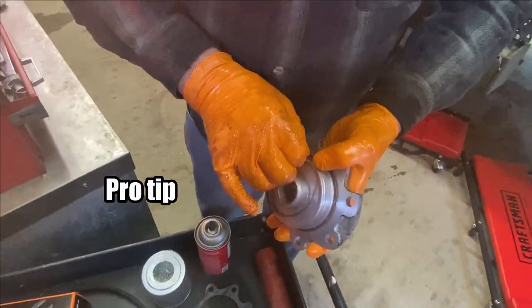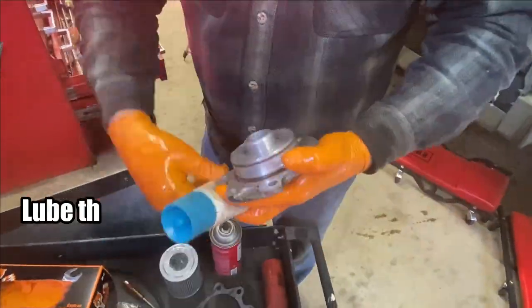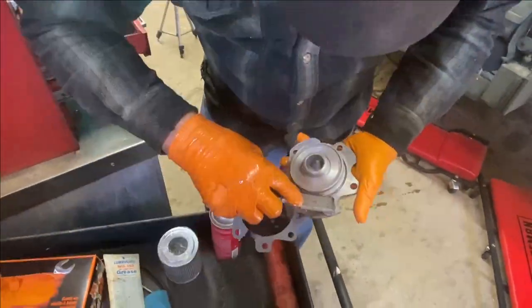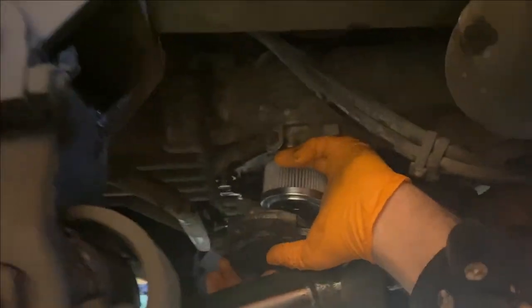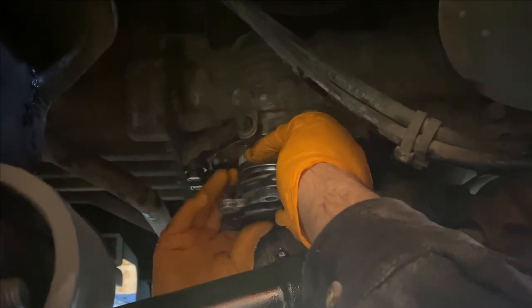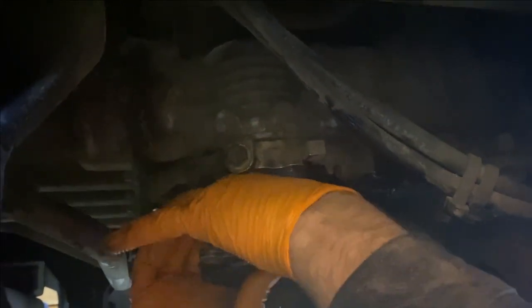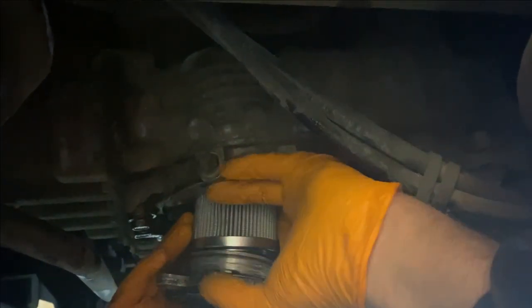After putting the O-ring on, running a small screwdriver around it will take out any rolls that the O-ring might have. Okay, the filter is in the hole. Now you can fit the filter housing on it and push it up in there nice and hard, and it should pop into place, right? Well, if I put enough grease on it, it will. I'm struggling with it a bit. You know how it is when somebody's watching.